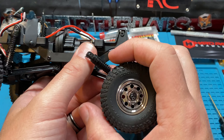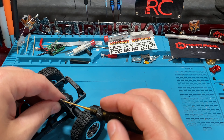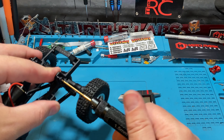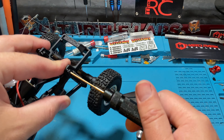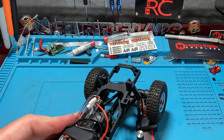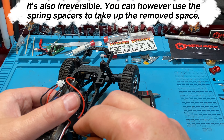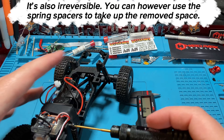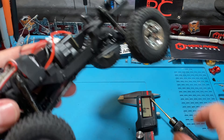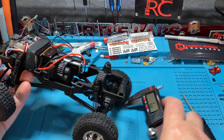If you're going to change to bigger wheels and tires, or bigger tires especially, you're probably going to end up rubbing a little if you do this mod. But I don't want to go big tires on this guy — I like to keep them kind of scale looking, and I think these tires are a perfect size. If we were to ever change out tires, we'd go with this size or maybe even a little smaller. One thing to remember: if you clip your springs, which a lot of people will do just to make your spring shorter, you are going to change the spring rate, which means your body weight and stuff like that will affect it more.